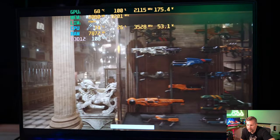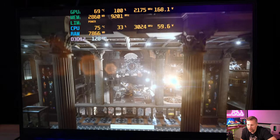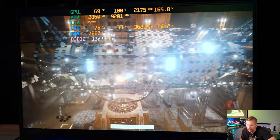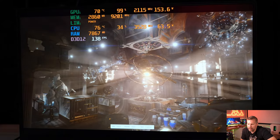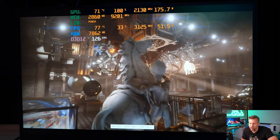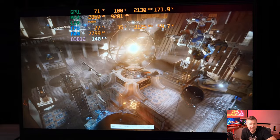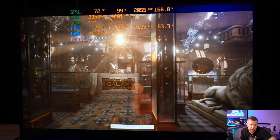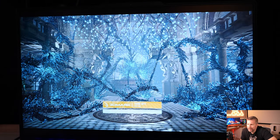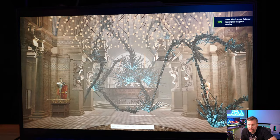Overall, we are seeing so far a consistently pretty dang good boost clock, doing 174 watts again. We've seen a few moments where it dropped down to like 160, 165 watts, but that's normal, as the load on the GPU maybe is not always sustained 100% perfectly, and that's typical of video games. What I'm looking for in this test is a consistently high amount of wattage to the GPU, especially when we have 100% GPU utilization. We want to be seeing typically at least 170 watts of power most of the time as a minimum spec. Like we saw just a moment there, 180 watts. Occasionally we'll see a little boost above 175, but the average wattage we want to see is over 170 for one of these high-end spec systems. Like the Aorus 17X was a great laptop, but we did not see consistently high wattage pulls on the GPU, and as a result, we also saw reduced performance and reduced numbers in games and in Time Spy.